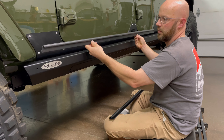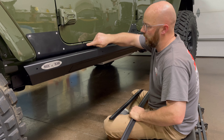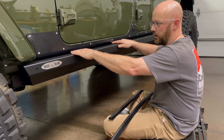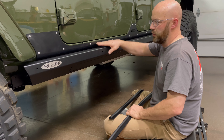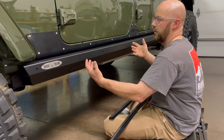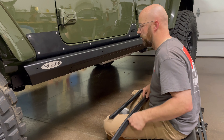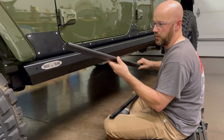There's a rubber bump strip or weather strip that the slider pushes into to seal up this gap. Since we've done the plate on the body, that needs to be spaced correctly so we don't cut into this weather strip. We're going to mark the placement of this weather strip on the body so we can put it on straight, then remove the slider, put on the bump strip, and make a shim the same thickness as the slider so it puts a little pressure on the weather strip but not enough to puncture or cut it. This strip attaches with double-sided tape.